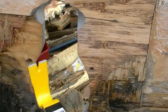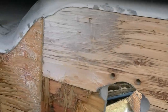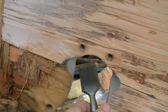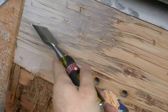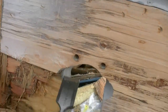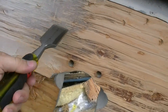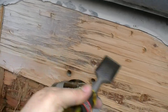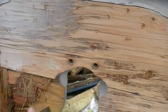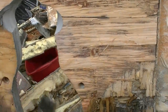Once you get past all that mess, then you start breaking out the hammer and the chisel just little by little, getting it out. You'll also want to make miscellaneous relief cuts, which gives you a breaking point so when you're going up with your chisel and prying out, it gives a spot for the wood to break. You can do that with a chisel, a Dremel tool, or an angle grinder — just be careful not to go through when you get close to the hull.